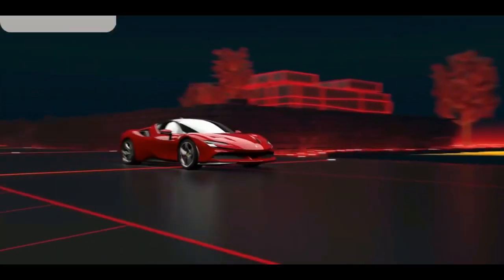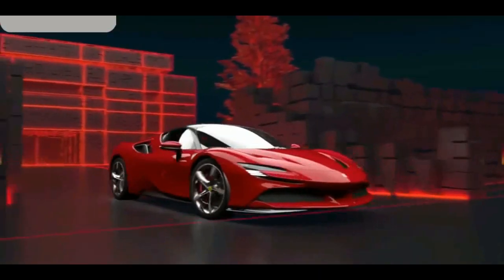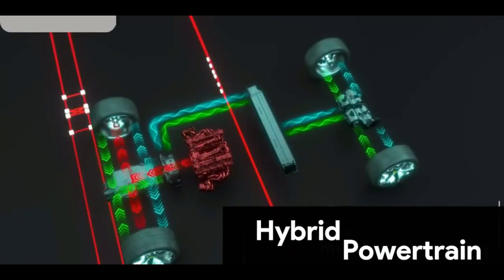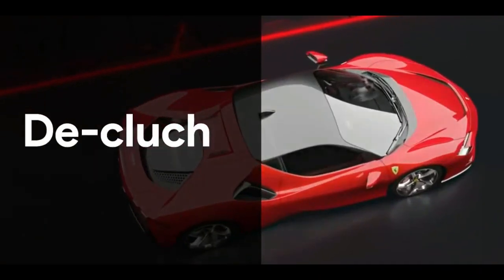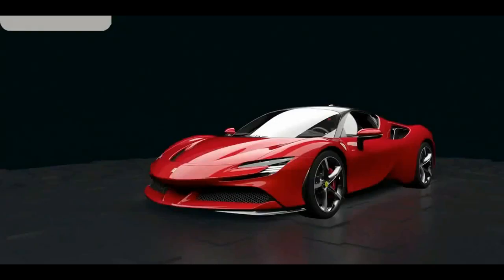Still, the car can actually go in reverse even though it doesn't have a dedicated gear in its gearbox, thanks to its hybrid powertrain. When reverse is needed, the logic board declutches the rear of the powertrain from the wheels, and only the electric motors at the front drive the front wheels. So the reverse is pure electric — cool concept.